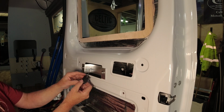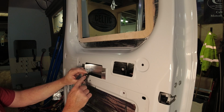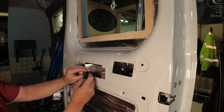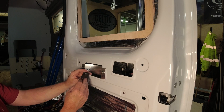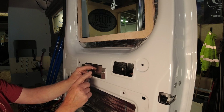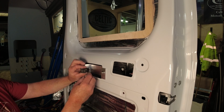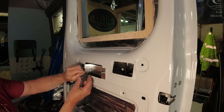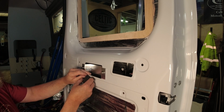So now you've got this part, which has got the brass solderless nipple in there. There's 4 stainless steel bolts holding it through. It's a 3mm Allen key, and I think it's about a 5 or 6mm nut. So what we're going to need to do at this end is remove these. At the moment they're just finger tight. I've put a spare one in the pack because inevitably you're going to drop one. It's going to land down there or bounce halfway down the road.